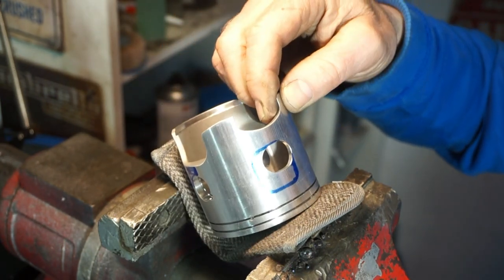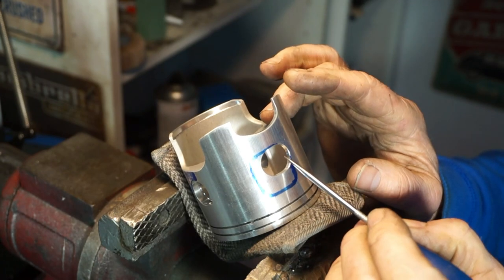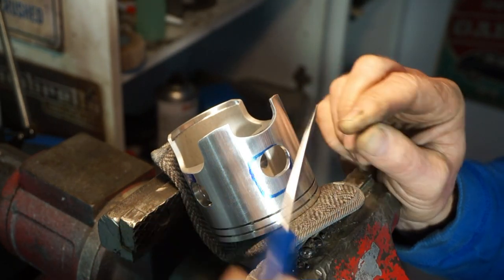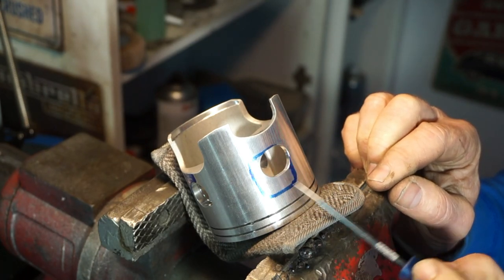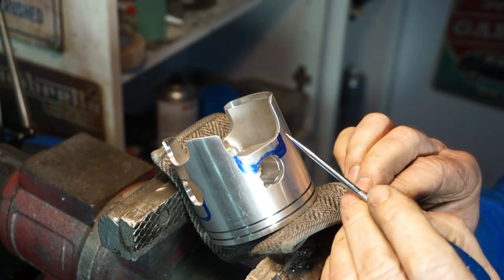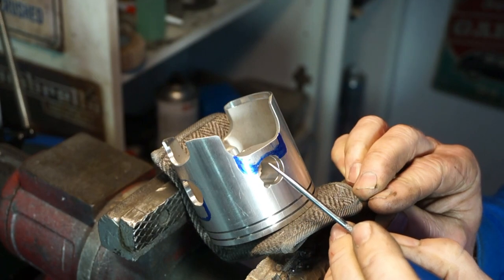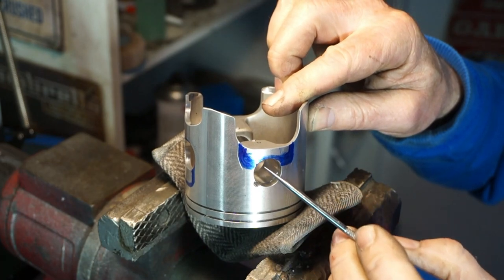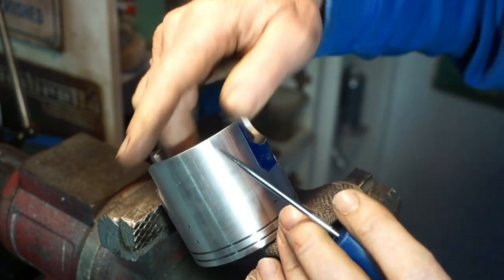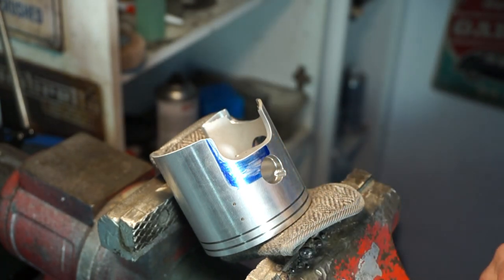Okay, we're going to make a few modifications to the piston. We're going to cut this window out bigger, and in the position it didn't line up correctly with our boost port, so we're moving it over and we're going to line it up with our boost port. Because our reed valve comes down here and blocks the flow to our port, we're going to cut this away so it flows through the piston and into the port better. So that'll improve that a little bit. On the sides of the piston, as you can see, that's where my transfers are lining up on the piston. I can't cut that all away, obviously, because you'll have nowhere for your circlip to go and you'll weaken the piston too much around the gudgeon pin. So all we're going to do is take this sharp edge off and radius in and flow this in. And the same on the other side. We're going to take that part of the skirt out and then the rest will just be cut down and flowed. So that's what I'm going to do now.